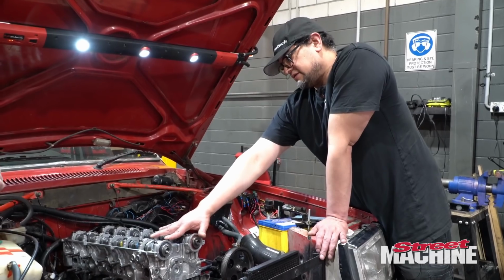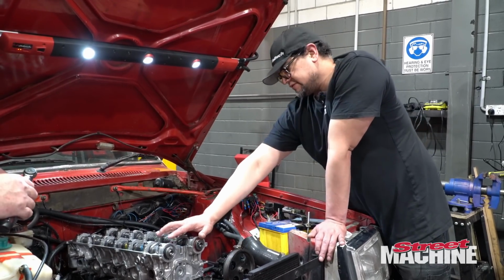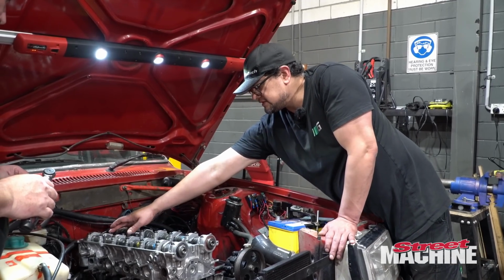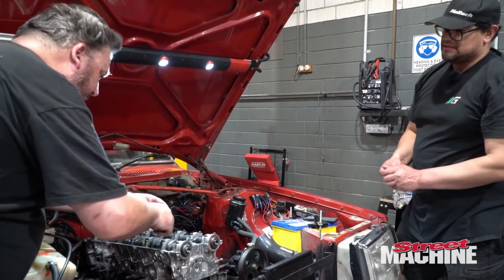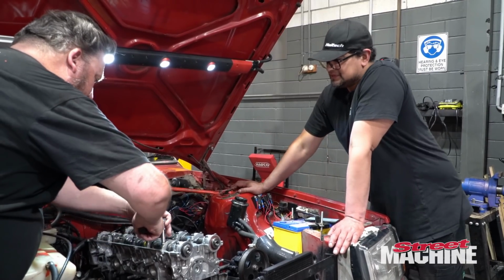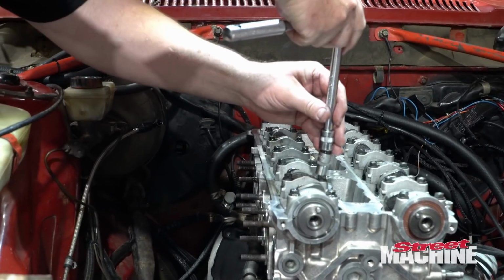So this is the key part when you want to keep track of what you've done. We can see we've got that one, the first 2, and the 6th with the lobes up, so they've got no tension on them. So we can undo them and then redo them. So just enough to take the tension off. Does it matter which order I undo? No, it doesn't. Just as long as you do them back up, that's the key. Okay, so just to take the tension off.